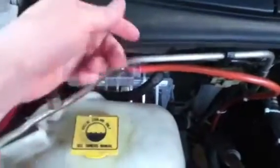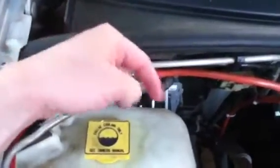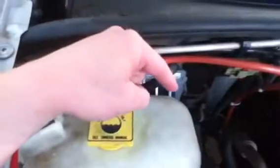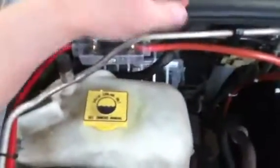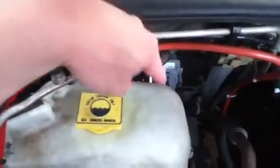So, disconnect, move out of the way, unplug, take your bolts out, take the ECM, clean it, take your plugs, clean them, put dielectric grease on the plug faces, make sure there's no excess grease on it, wipe it off, take your pins, bend them at a slight angle upwards, 5 to 10 degrees, then put it back together after you bolted it in, and then plug it in, zip tie them tight, make sure you pull those plugs all the way in, and that should take care of that.